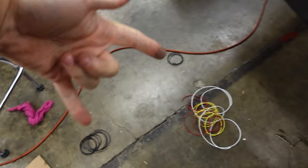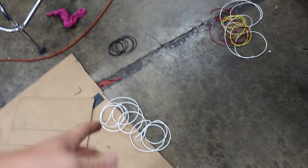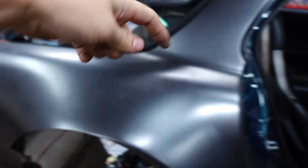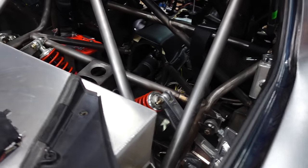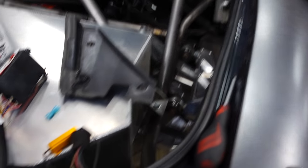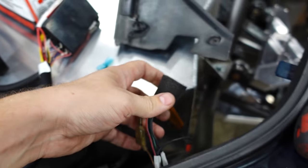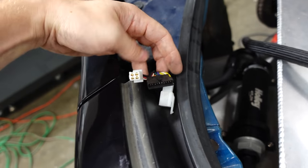I want all of that on this car. The first version of this harness is going to be very simple. Those two wires there do braking low and high. The two black wires are for ground low and high as well, and the white ones I consider data lines — this one goes all the way across from that one, and the other just goes from here down. We'll have one plug somewhere in here that's four wires: left turn signal, right turn signal, brakes, and running — and those will all plug into these here. That's where the normal FD tail light story ends.